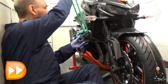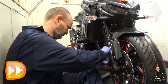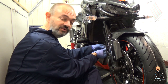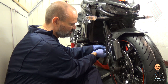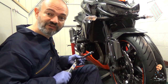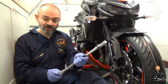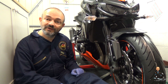Now you can of course, when you've tightened these up, do exactly the same thing again - bit of paint pen, nail varnish, marker pen, whatever it is. Again, a bit on the calipers, a bit on the nut, just to mark where they were torqued to, and again just to check if those things start to move apart after you've gone for a little run. And I'll zero off my torque wrench - not something I've mentioned before, but I'll always turn it to its least resistance when storing it, because you don't want it to be under any tension.